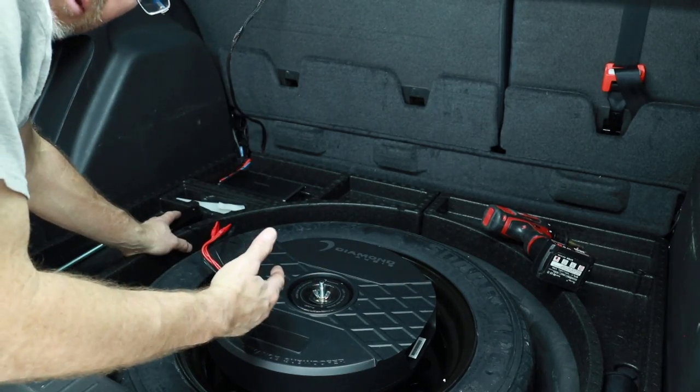We have a 500-watt amplifier in this car that we're going to hook this up to. Sub is connected — let's get up front and take a listen. Sometimes our expectations are skewed by what we're looking at, and it's always a joy when something moves the needle forward. I'm happy to say this is one of those instances. We've been sitting here listening for a couple minutes — and we rattled it loose. I went back with pliers and really wrenched down on that bolt. It needs to be as tight as humanly possible — finger tight absolutely did not cut it. Within two songs it was rattling back there.